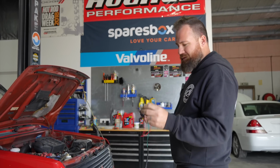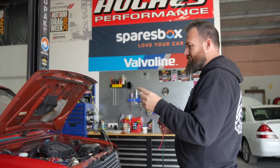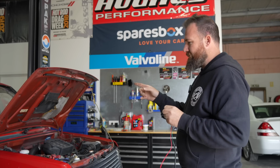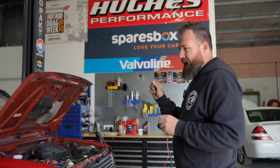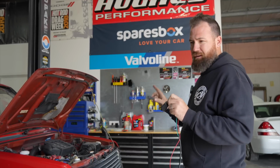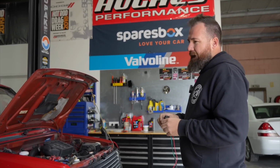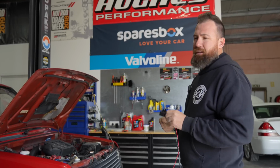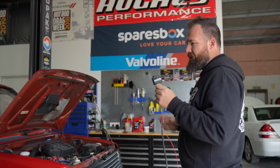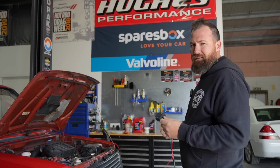We're also going to be wiring the boost gauge power and the boost gauge dash lights from the head unit loom as well. And I'm also hoping, because Japan's awesome and this has a head unit that's been in it forever, that it has a patch loom from the original Kenwood head unit that's in it to the Pajero Mini loom. And if that's the case, we can actually pull that loom out and make a breakaway loom on the desk. I bought a Kenwood head unit purely hoping that Kenwood haven't changed the connector. So if they have changed the connector, then we're also going to have to change that section of the loom into the adapter harness. And I'm hypothesizing that the adapter harness even exists at this point.